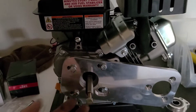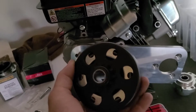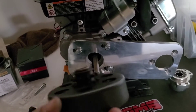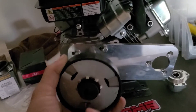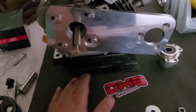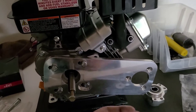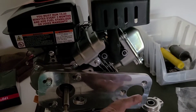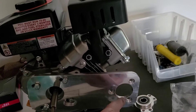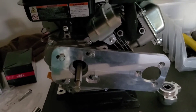I'm not gonna space the clutch yet because I'm not sure which side is going to be facing out. The nice thing with these centrifugal clutches — if you didn't know, now you will — you can run them this way or you can run them this way. So we're gonna see what gives us the best offset to get our plate lined up with the stock plate, as well as getting our chain where it needs to be. If the clutch is running one way and it catches the chain out here, then our inward sprocket would go to the back. If the chain's flipped the other way, it would catch this sprocket and then the outward sprocket would catch to the rear sprocket. Let's get it on the bike.